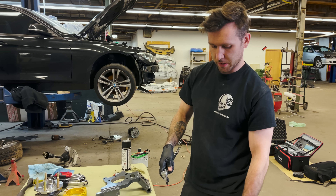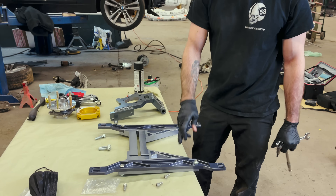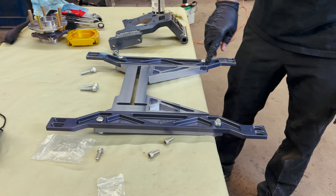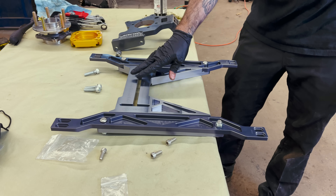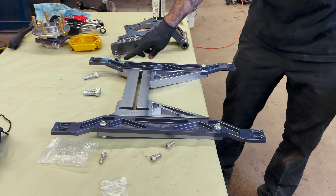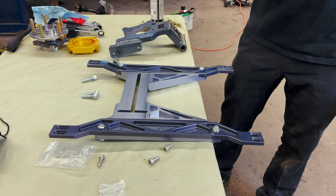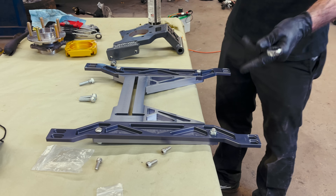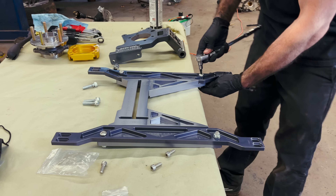So when you're making the power cradle and putting these side pieces on, put them on this way — not this way. Because when this is mounted up, this is actually facing down and the actual head of these guys, which is rounded, gets really close to the control arm. They're made to sit like this — not the other way. Yeah, we had them on backwards.